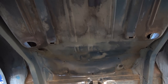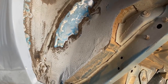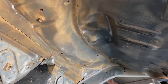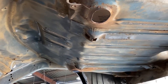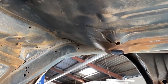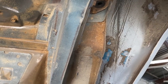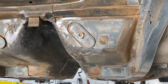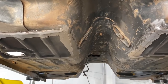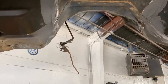That's just after one little scrape, and now we've pretty much smoothed everything out. We're going to spray on a bed liner called Raptor Liner — like the Ford truck — and that stuff is beautiful when you spray it on. We'll put a rust inhibitor on first. As you can see, a lot of the blue paint is still showing everywhere, which shows the whole bottom of this car is in really excellent condition. It's just too bad we had to patch the floor, but I'll take that over replacing the entire floor.